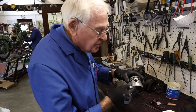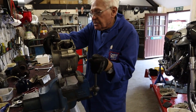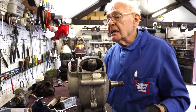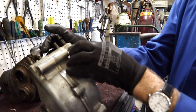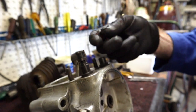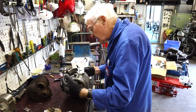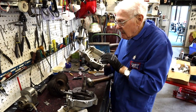I'm not too happy with the ring movement - we may have to get to the club and see if we've got a new set of rings. Then we get these nuts out without too much drama. On this side you can see the engine number and 'SS Semi Sports' which is quite nice - SS Semi Sports motor. These are the followers - paint them red for exhaust, pop them in the box along with the nuts. That should come apart without too much aggro - just a touch with a mallet. Here we go, we're inside.